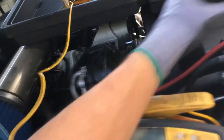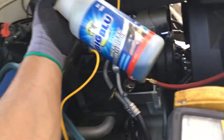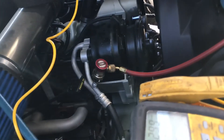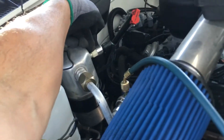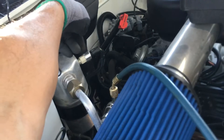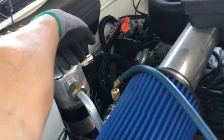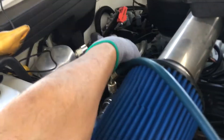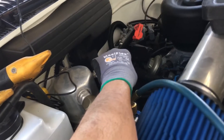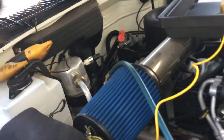I've shown videos before where I spray bubble soap and find the leak — UV dye coming out through the case seals, which are notorious. Another notorious leak point: when someone tries to change the pressure switches, which were notorious for failing, they'd buy an aftermarket or OEM switch. There's a little o-ring underneath. They'd use a standard-size o-ring because it looked close and it would become a leak. Or they'd put a wrench on it, over-tighten it, and it would leak. These only need to be hand-tight with just a little oomph — overtightening will cause it to come back as a leak later.